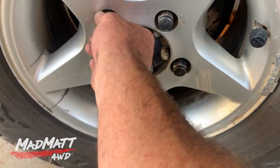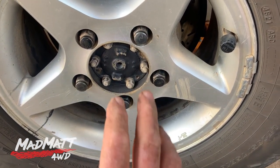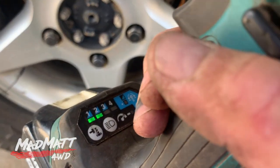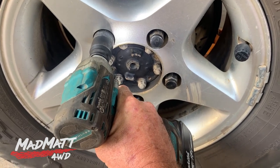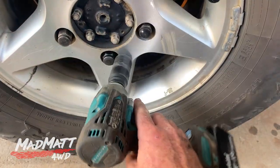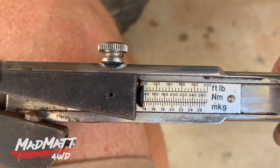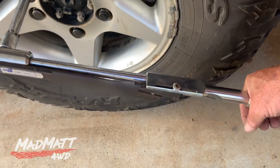The wheel's on. I put all the wheel nuts on by finger — finger tight, so they're just loose, just on two or three threads. I prefer to do that rather than put the nut in the rattle gun and risk cross-threading. My rattle gun is on a light setting — all we're trying to do is use the rattle gun to bring the nuts up against the face. Not really trying to tighten anything. Now we grab the torque wrench and set it to the spec for our wheel studs. Obviously every vehicle will be different, so Google it or look in the workshop manual for your vehicle, and then we just tighten that up.